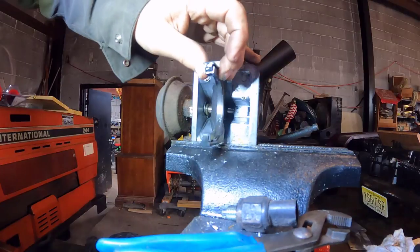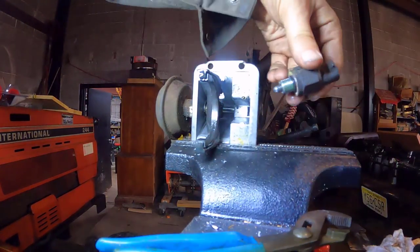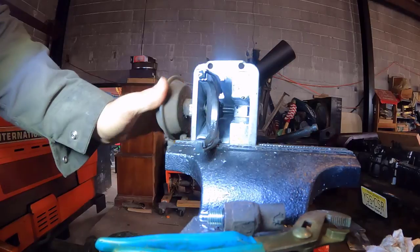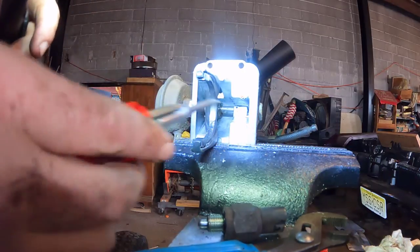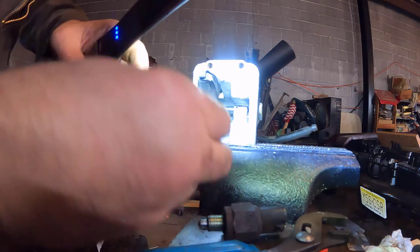So you have to get your old shift actuator out. The way to do that, first I unscrewed the switch, which is right here. Then I tried to unscrew this, which was stupid because I broke the housing. And I realized there are three E-clips. Once you pull all three E-clips out, the center shaft pulls right out this side, and then you have your fork nice and loose.